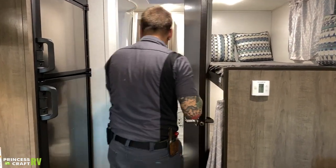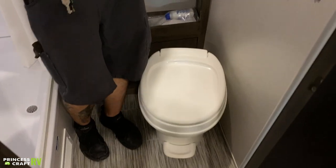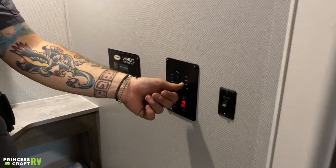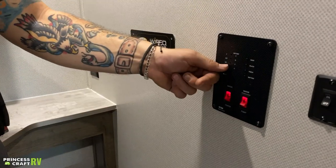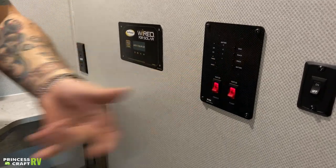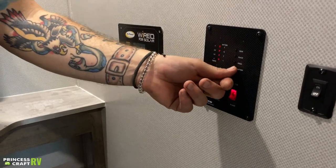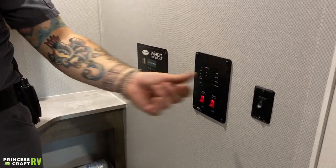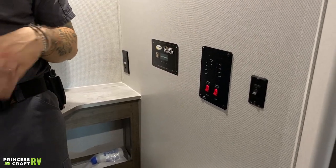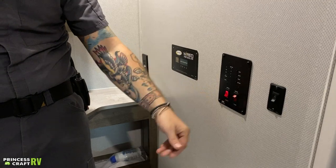Moving on here into the restroom. First up, we have your light switch, but we also have your courtesy panel right beside that. This is going to give you a real-time readout of where your tanks as well as your batteries sit in level of full — the more lights we see on the display, the more full your tank is. Battery reads full anytime you are plugged into shore power. So to get a true readout of where your battery sits, we unplug from shore power and then test here at this location. Fresh water is full — that's how we do our testing within these units. We pressurize the system with the 12-volt water pump and bring that water from the tank to make sure there's no leaks in the system. Black water is empty as it should be. Gray water is empty as it should be.